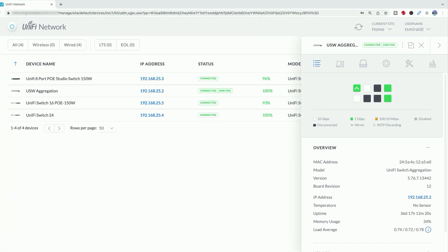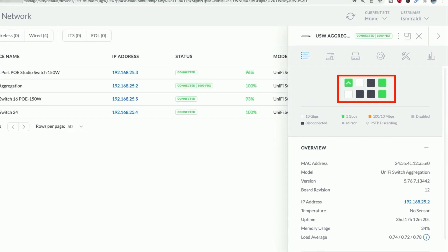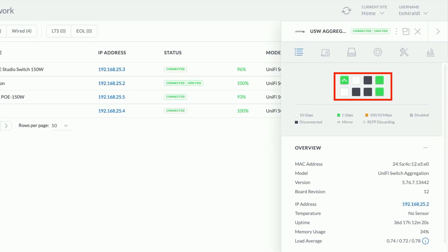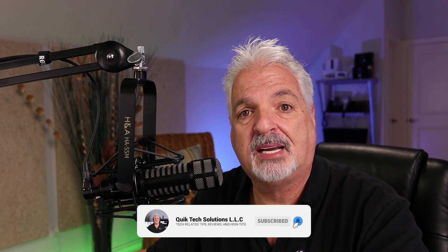What I want to focus on in this screenshot are the two white status lights on ports 2 and 3 — they signify 10 gig networking. What I want to show you today is how I set up 10 gig networking between my 2018 iMac and the Synology 1621+. We'll go over the hardware, look at the actual physical connections, the adapter cards, and then do an iPerf speed test to show you the speeds I'm getting. If you're interested, stick around.